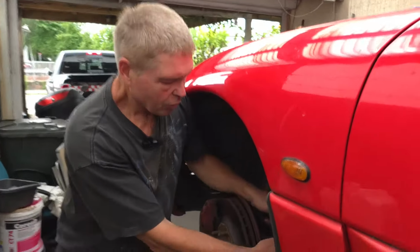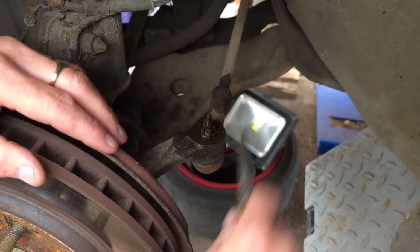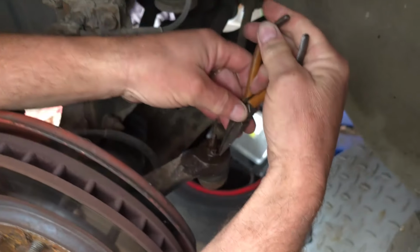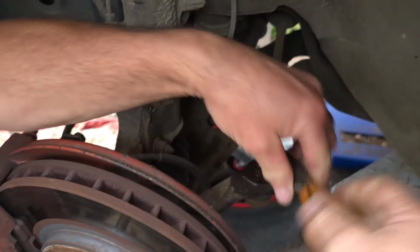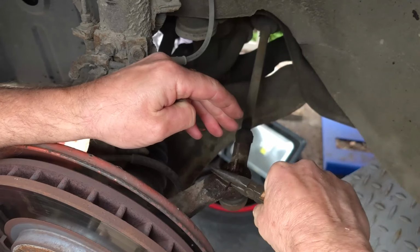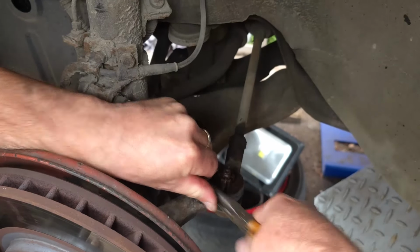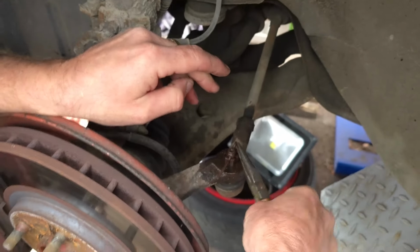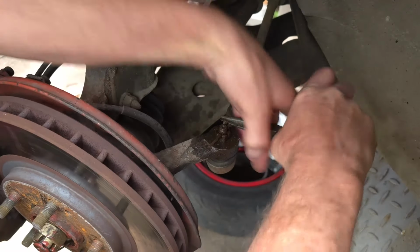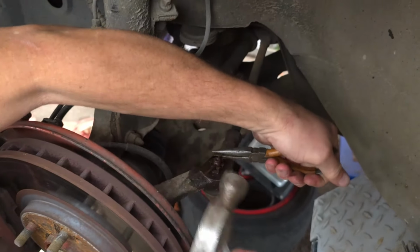So first of all, we've got a split pin here that goes through this nut to stop it coming undone accidentally. To loosen that out, long nose pliers. I'm going to have to work at an angle here so you can film at the same time. Sometimes these things rust in. I'm hoping that this one is free enough, because they can be a real pain sometimes to get out. It looks like this has been replaced at some time, so it's fairly free. Okay, I'm going to cheat a little bit here. I'm going to grab a hammer and see if we can tap that out.